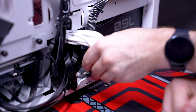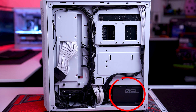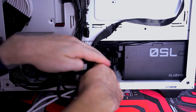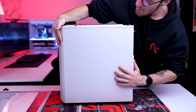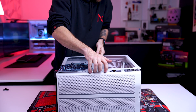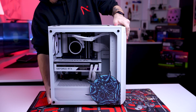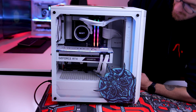Lastly, if you have a modular power supply, you'll need to check the connectors on the power supply itself. If not, you can just skip this step. Locate the power supply at the top or bottom at the rear of the case. Carefully push the connectors you can reach towards the power supply to check if they are clicked in all the way. We recommend checking only the ones that you can reach with ease. Now that's all done, put both front and back panels back on, plug everything back in, and turn on the PC to see if it's all working correctly. If you're still having issues with your PC, get in touch with one of our friendly staff — we're always happy to help.